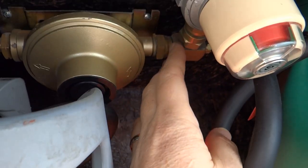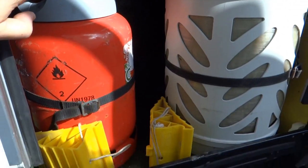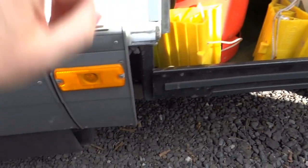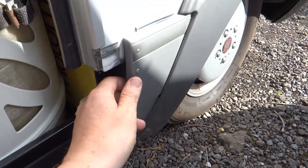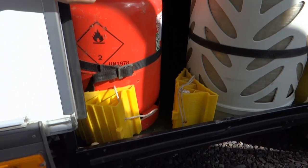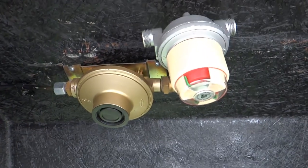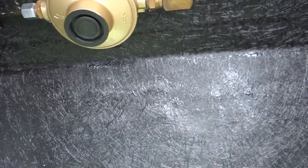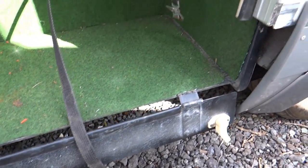That's the auto changeover unit — it's attached to the regulator at the moment, so that'll all stay. The pigtails will come off and we'll attach them to the new bottles. Then we'll bring the filler pipe down. There are two options for placement on the skirt: one bit is quite flexible and not great for support, but this bit over here is far more sturdy — though not very big, which is why we've gone for the small filler unit. I'm going to get the old bottles out. There's the auto switchover valve, and that's where the pigtails will connect on either side.